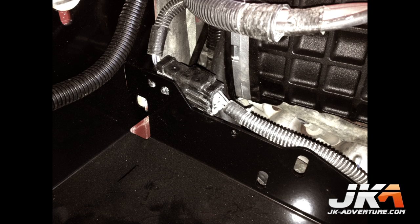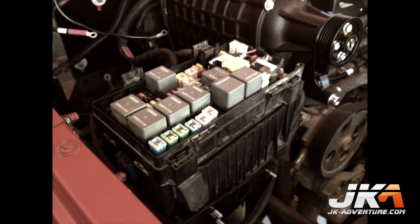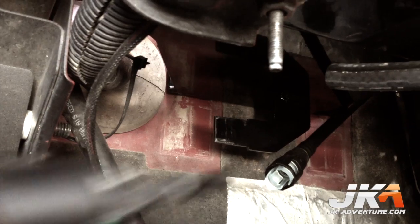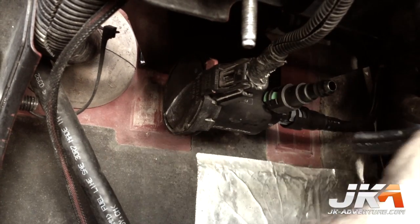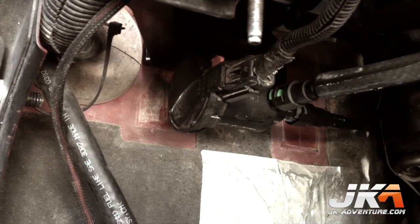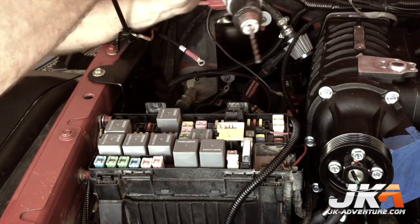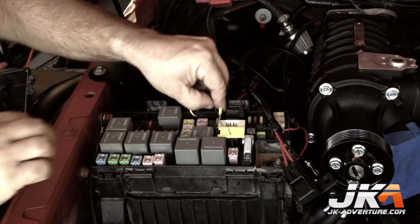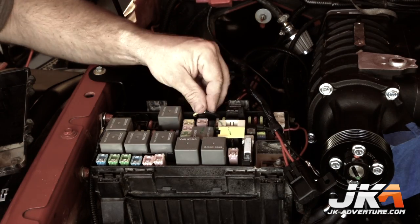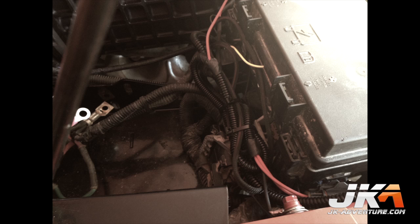Reconnect the wiring harness near the back of the passenger side and slide the trees back into their mounts. Reconnect all fuse center blocks and lock them down with the integrated clamps. Slide the EVAP solenoid onto the posts on the bottom of the battery tray, then connect the EVAP solenoid control plug, the EVAP tube, and the EVAP solenoid hose. Reconnect the fuse center power cable along with the red wire from the Magnuson wiring harness. Drill a small hole in the back wall of the fuse center and run the yellow wire from the harness through it. Pass the legs of the M25 fuse through the integrated fuse tap and reinstall the fuse in the panel. Connect the black ground wire from the harness to the passenger side body ground. Zip tie all wiring neatly.